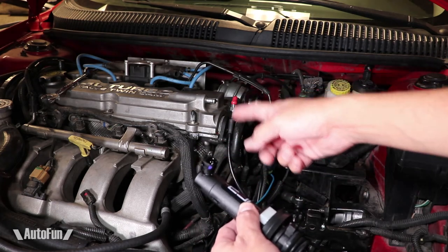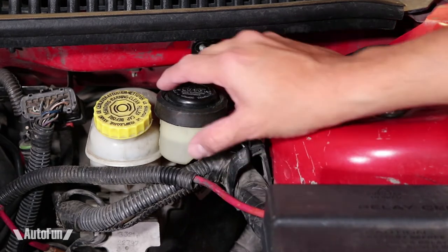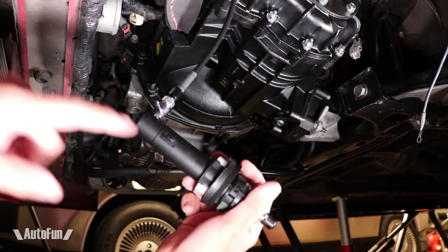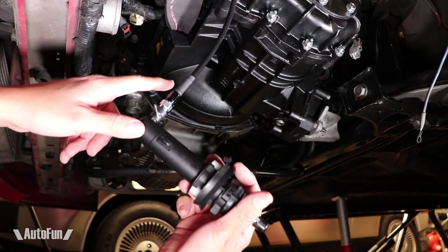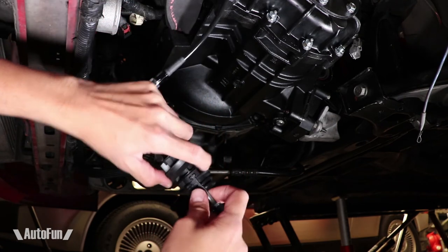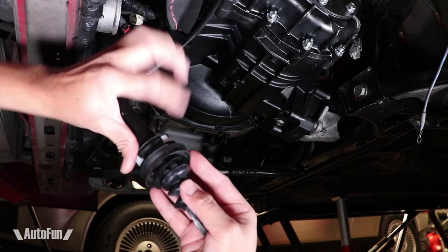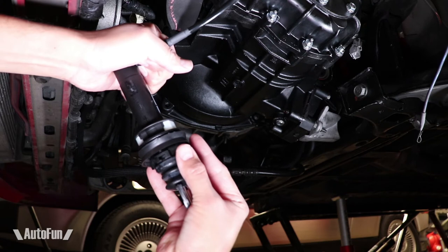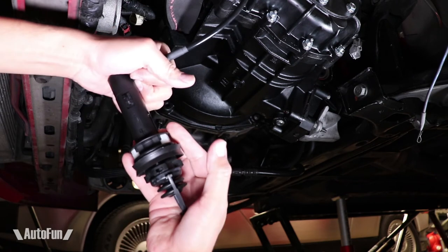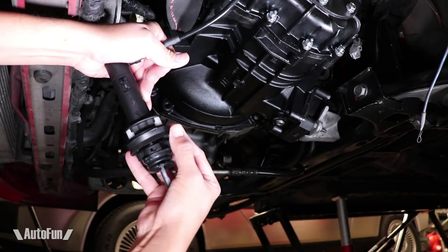I can now connect the fluid line to the slave — time for the final bleeding. I first make sure I have enough fluid, then remove the cap so we can vent out any remaining air. Notice I have the slave cylinder tilted to help the bubbles come out. If it's a brand new cylinder, I remove the locking tabs to release the front — one here and one here. I carefully hold the cylinder from coming out too far. The service manual requires you to pump the slave a minimum of 10 times. I do this slowly to encourage any air to escape, then lock the plastic tabs again and proceed to install the slave cylinder into the transmission.